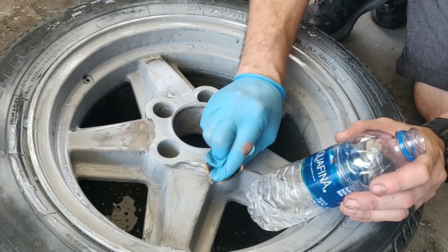You can see where I've applied it. I'm going to take 220 grit sandpaper and lightly sand that away — it only needs to sit for about 20 to 30 minutes. The second time I still used too much hardener, so I went with even less on the last coat. It's really easy to apply: put a glove on, use your finger, and smear it into any small divots. This rim was really, really destroyed — all four of them were — so the goal is to get it the best we can and make it look as nice as possible even from a foot to five feet away. After sanding the glazing putty I threw some degreaser on, scrubbed it down, rinsed it off, wiped it down with alcohol, and I'm going to spray another coat of primer to make sure we don't have anything else major to fill before moving on to painting.